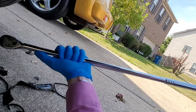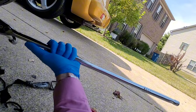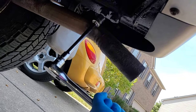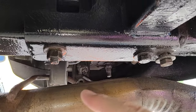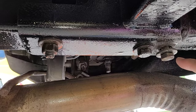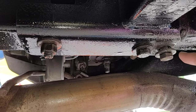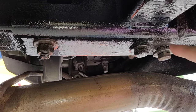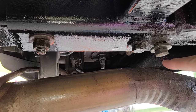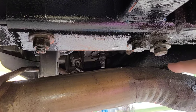Here's one of my favorite tools working on big trucks — this is a two-foot long ratcheting wrench. I'm using this to remove these hex head screws as well as this nut. I broke all these fasteners loose and was turning them by hand, then figured I'd use the air tool to take these off. As soon as I hit it with the air tool, the nut inside that's welded to the frame came loose. So now I have this fastener that I'm going to have to cut off.